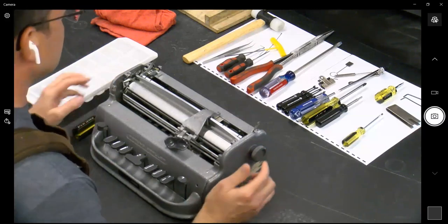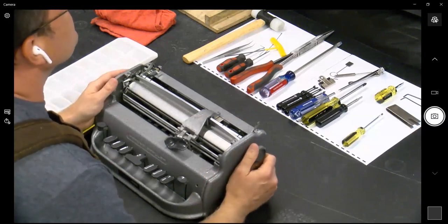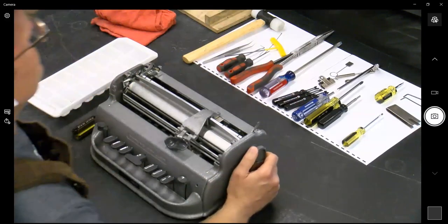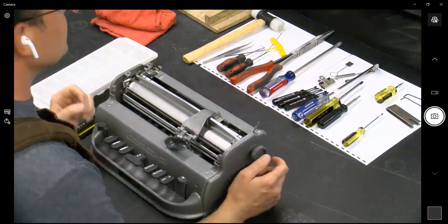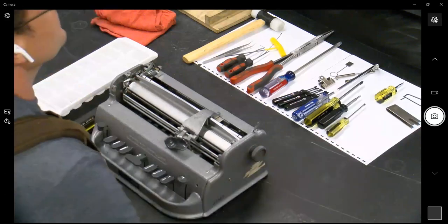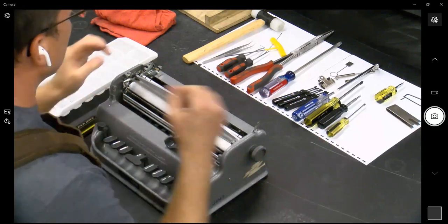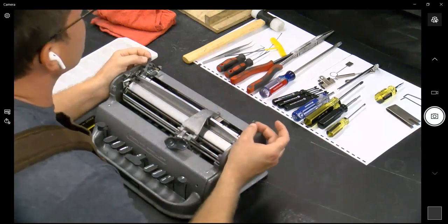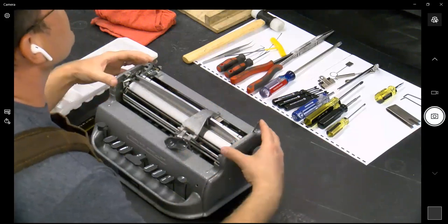There was a question about the older braillers with little knobs on the paper lock. Those knobs do need to come off — use a very tiny Phillips screwdriver. There's a Phillips screw on the inside of the lever. If you hold the knob with your finger and thumb, or even a pair of pliers, insert your Phillips head into the small screw and turn counterclockwise. They do get really tight.